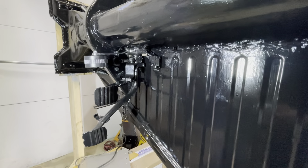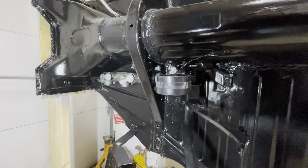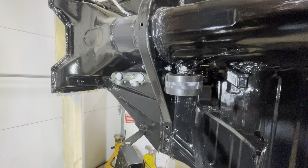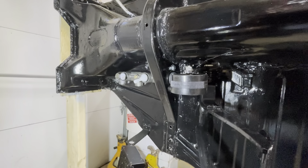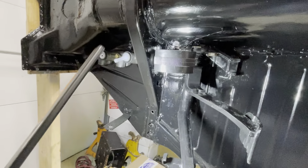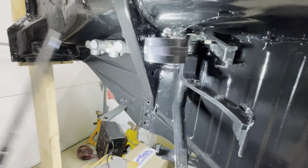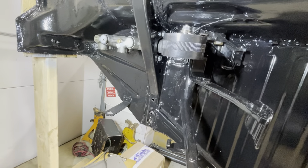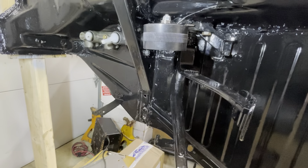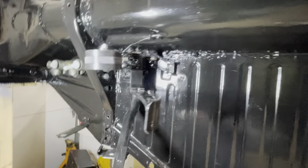After a little fighting I got the pedal cluster back in and the master cylinder is on. Those sleeve bolts for the master cylinder were a little long, so you probably saw me grind them down just a little bit — and then lose one of them repeatedly down in the bulkhead. I fished it out with a magnet. Keep in mind the bulkhead goes all the way down to that hole, so if you drop one you have to go fishing for it. Now I can start running the brake lines — I'll start with the fronts and then move to the rears.